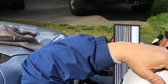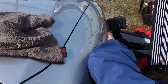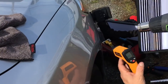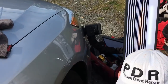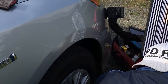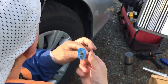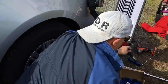I'm gonna get it just a little bit warm. I've got my Scorpion butane-powered heat gun heated up there, and I'm probably just gonna get this to about the 70–80 percent — 80 degree mark. See where we're at — we're at a hundred now, so let's just stop. And now I'm gonna drop a tab in there. I'm thinking I want a crease tab, maybe a little bit bigger. Here we go, probably gonna take this crease tab and put it right there and try to get the majority of that meat out.